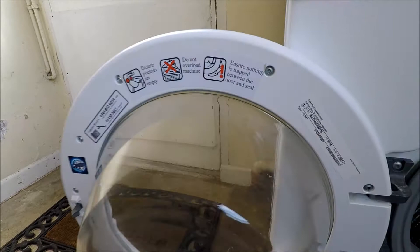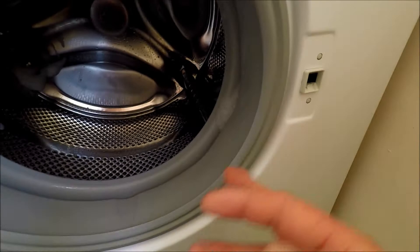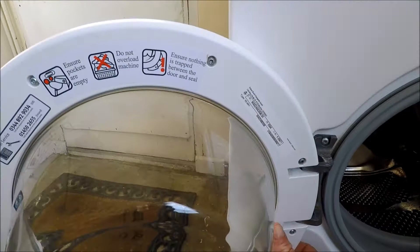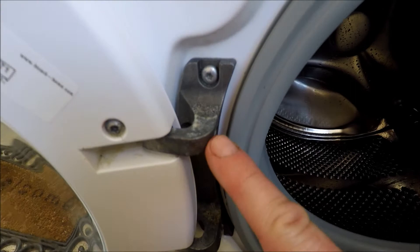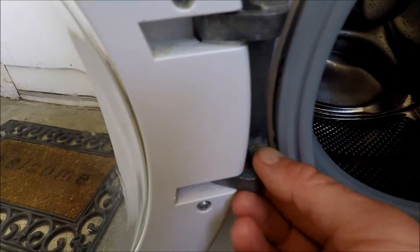You may find that if your washing machine leaks or drips water on the floor when it has a load in, the door seal may be mouldy, not creating a good contact around the door aperture. Also, never slam or kick the door shut on the washing machine, as the hinges are often an aluminium moulding — they will snap and shear off if abused. It's only a lightweight, cheap die-cast alloy, very thin, so it will snap and bend the door out of plumb.